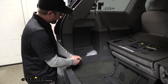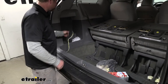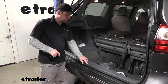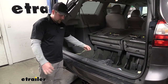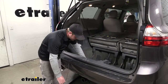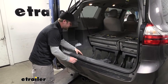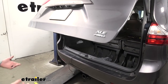When you're not using it, you kind of wind it up and keep it in your storage compartment out of the way. Whenever you are ready to use it, you'll just grab it and drape it over the threshold. Anywhere on the threshold is fine where there's weather stripping, with one exception — you want to stay away from the latch area, as it could potentially get damaged there. The four-way connector has a really long wire, so that's nice to have that extra length if you need it. Just drape it over and close your hatch on it, bending it to get it to stay where you want.